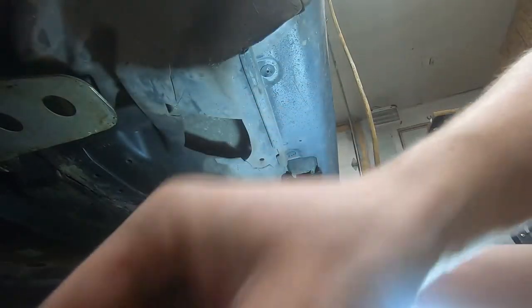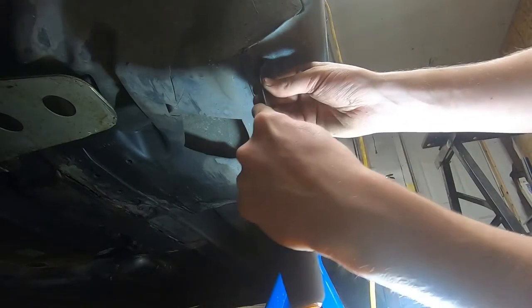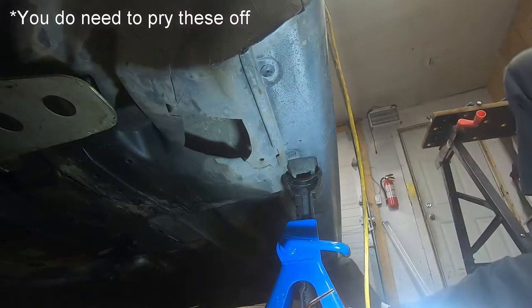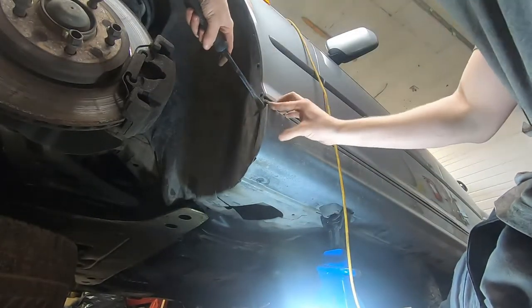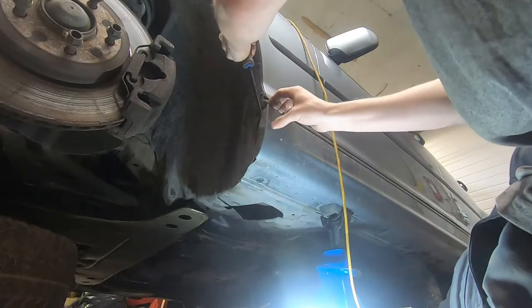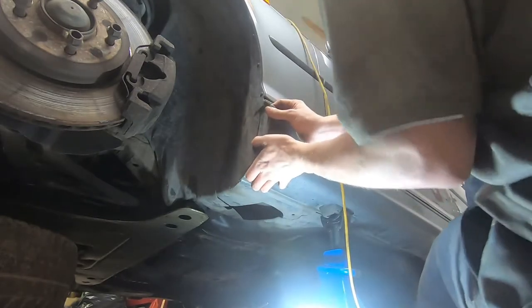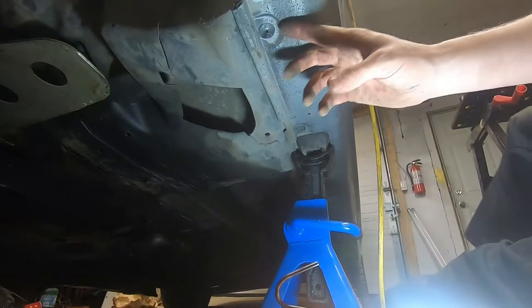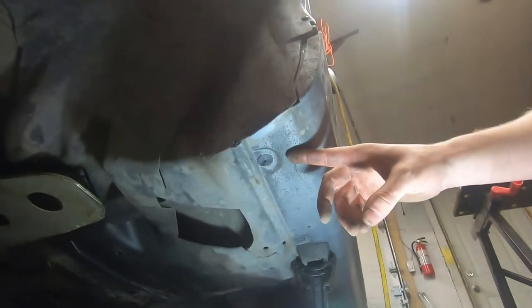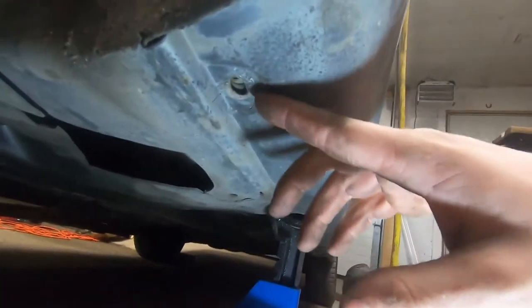You can see the two pieces are pulled out and now these are just sitting in here — you can pry them out, or you can actually just leave them because when you pull on the skirt they will pop out. Just grab this and pull it out — you just have to pull pretty hard, don't be afraid of it. There are two white clips that it unclips from up here, and then you have to pry those little pieces out so this will pull out of the way for you to pull the inner liner out from underneath. I used a smaller screwdriver to start them and then a bigger one to get the leverage and pop them out.